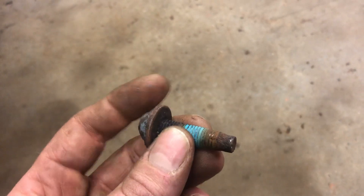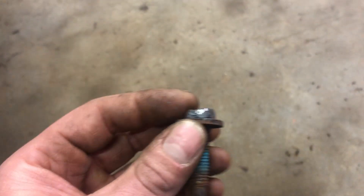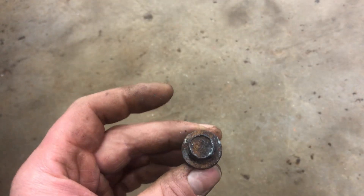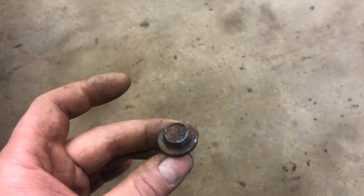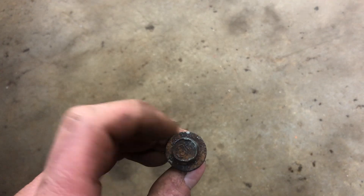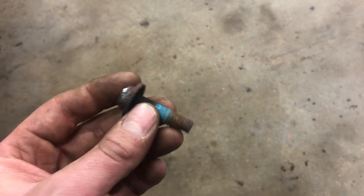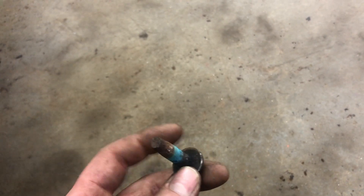I've pulled a few beds off Fords. Fords are different - Fords have a carriage bolt, which is a bolt with a rounded head and a square on the bottom. The bolt sits through the top of the bed and that square goes into a square in the bed to keep it from spinning when you take the nut off the bottom. In theory it's great, but in actuality they spin inside the bed. So what you do with a Ford is go to the carriage bolt, grind down the edges, get a little paint off, make the bolt shiny, take your MIG welder and zap three good dots on it. Then get underneath there with a torch, heat up the nut, and zap them right off.